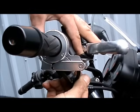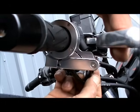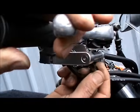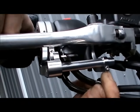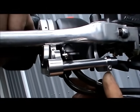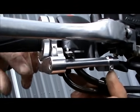Okay, so in order to set the cam height, we're going to rotate the support up or down as you need to. You're going to pull the brake lever over the cam and rotate the support so the cam just touches the bottom of the brake lever right there. I'm pushing the support up. The cam is just barely making contact with the bottom of the brake lever,